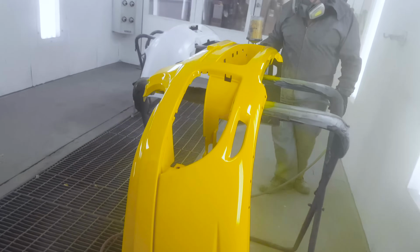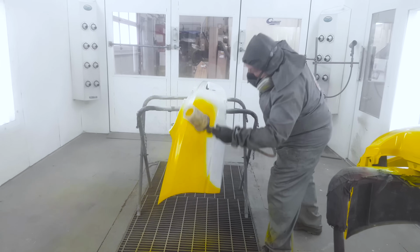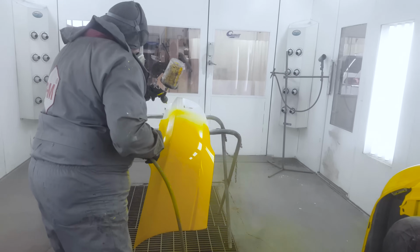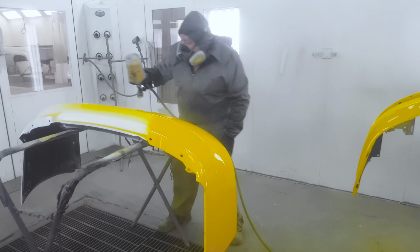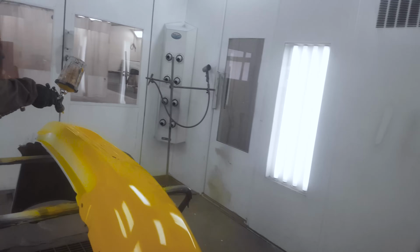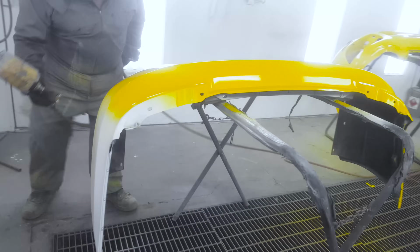So you want to try and get the first coat to go down as nice as possible. You're going to spray it and try and get it to flow out and not go on dry. I've always tried to describe spraying clear coat, and single stage will be the same way. It's almost like spraying hot wax. As you get it down, it's trying to dry, and you want it to keep flowing out in one consistent application before one part of it dries and then you're spraying over a bit of dry product. So you want everything to go down as wet as possible, and that's controlled best by the hardener and the reducer choice. The slower that you choose, the longer that you have to apply, but also the longer your drying time is going to be and the time that you have to coat it in between.